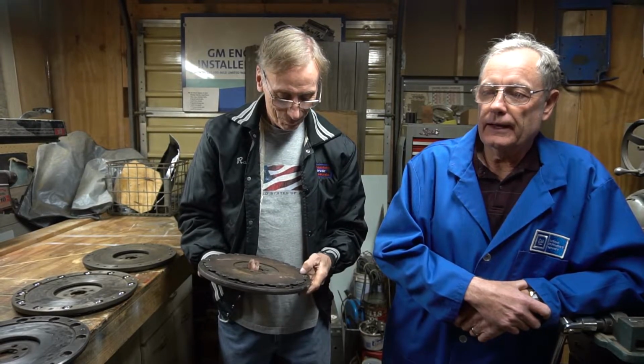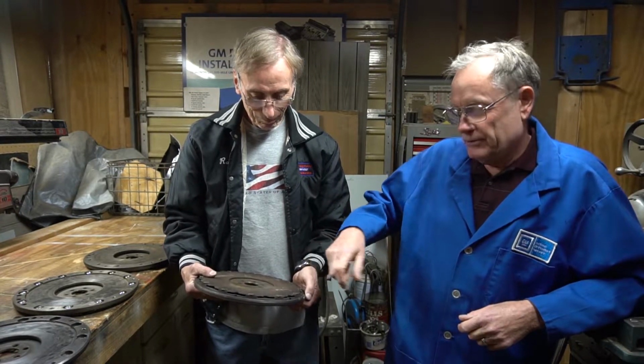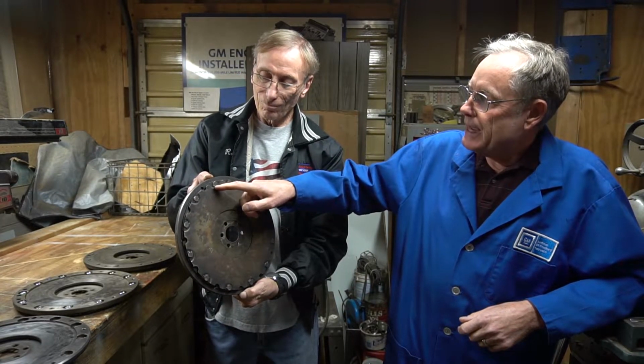And one way that I had seen people fix that rattling sound was they actually would take off that front shroud in the engine compartment and drill a round hole in the bell housing, then just take a stick welder and go in and bzz, bzz, bzz, bzz, turn the engine a little bit, bzz, bzz, bzz, whenever the flywheel came up, and tack weld the rivet to the plates in there. And that would have stopped the rattle.